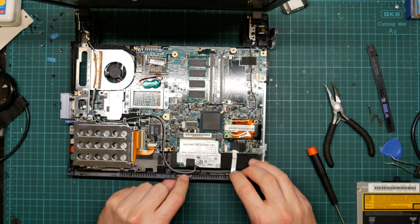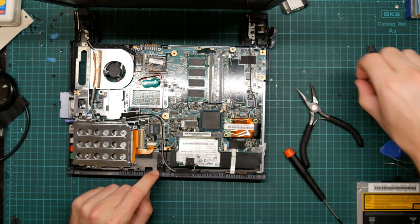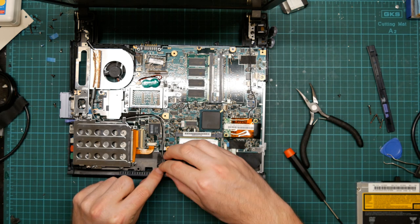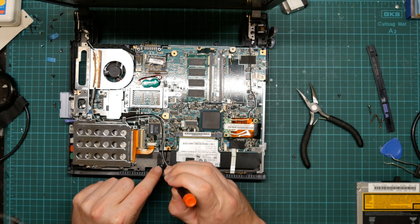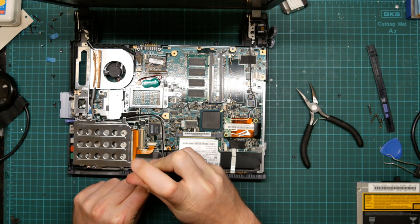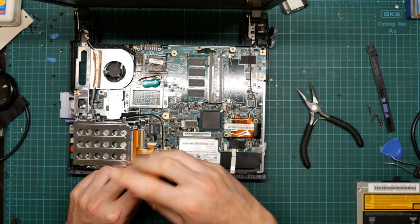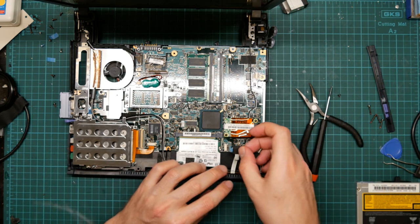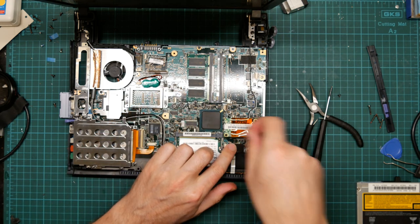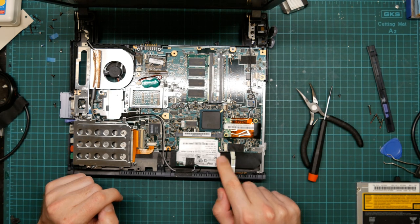Okay, well, so... goes on here, that thing clips on, hold the wire down like this, and if I remember correctly, this was a small threaded screw. On. There we go. Do need to reattach the cable. So this, make sure the tension bar is released. This pushes in like this. Tension bar goes into place. Tape sticks down. That's fine. I actually quite like these connectors. In terms of nasty motherboard connectors, these are some of the least bad I've met.